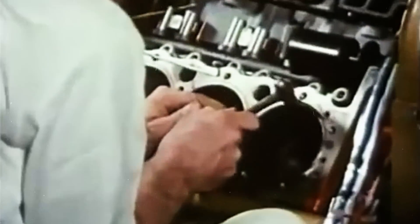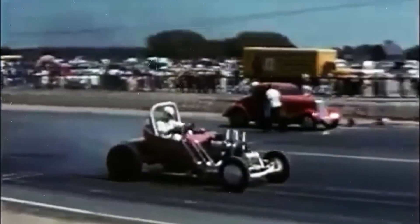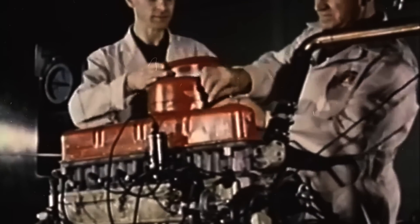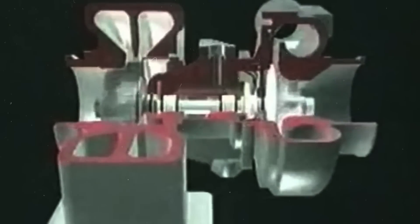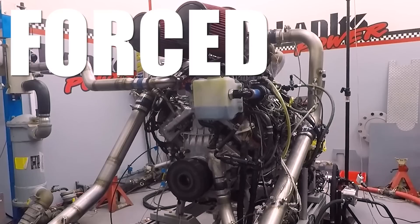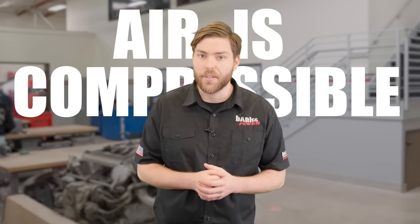Flow benches were first used for automotive applications by OEMs in the 1960s. At that time, most applications didn't see much variation in air density because there was very little restriction from intake to cylinder and turbos and superchargers were pretty rare. Now, however, about 50% of new vehicles on the market have some form of forced induction. Forced induction compresses the incoming air to get more air mass into the cylinder, making air denser. The change in air density from superchargers and turbochargers is dramatic, meaning using CFM is no longer relevant — and honestly, it was a flawed premise to begin with. The biggest failing point of flow benches is that air is compressible, and the density of the air changes with temperature, pressure, and humidity even though the CFM may stay the same.